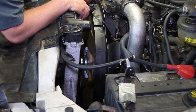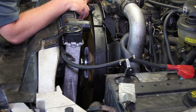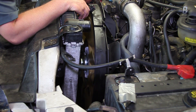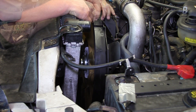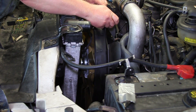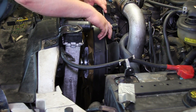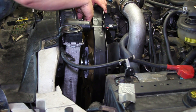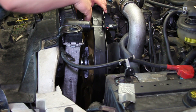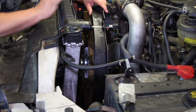This particular fan is just good old-fashioned righty-tighty, lefty-loosey. Some other models are going to have a reverse thread — there will typically be a warning indicating that — so be aware of that. One other thing to pay special attention to: get this wire harness locked into place properly in the fan shroud. You'll see it's locked in now, so I'm not concerned about those wires rubbing on the fan once we get this all assembled and back together.